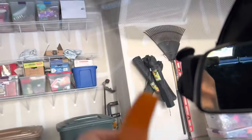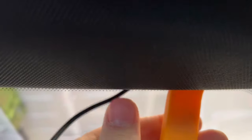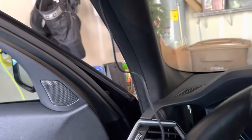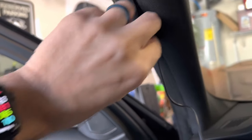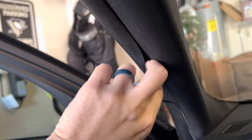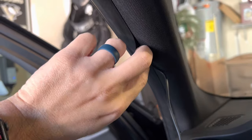From here I'm just going to run the cable connected to the micro USB port on the side of the dashcam, then run it along the headliner and tuck it in using a trim tool — or you can just use your fingers, you don't really need the tool. Run it along until we get back to the A-pillar. Once at the A-pillar, route it down and around where we pulled it away, then down the weather stripping — just follow that and keep tucking it in all the way down until you get back towards the base.